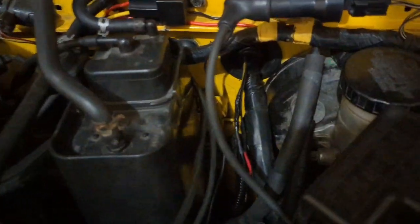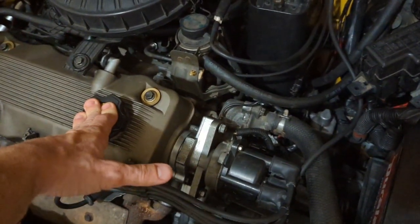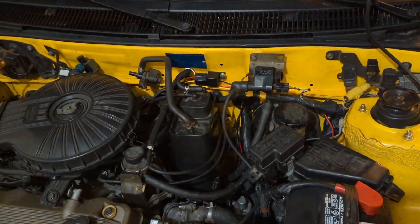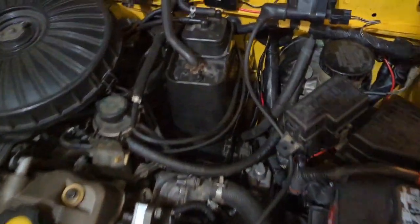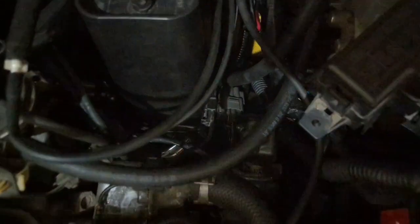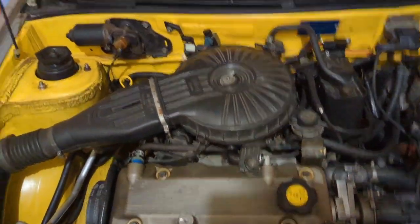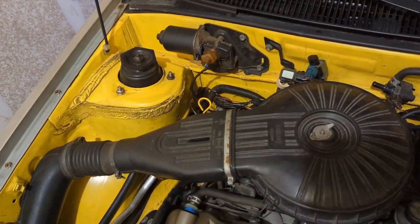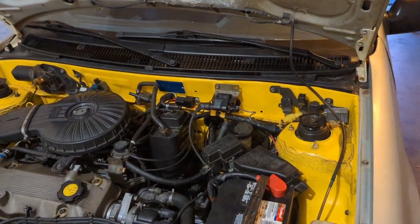I put a penetration through for the clutch start switch wiring. This is actually an automatic wiring harness — the engine came out of an automatic car — and I used its wiring harness and spliced in the needed connections for manual transmission components. The speed sensor for the manual transmission is actually on the cluster, and I wired that straight over to the ECU, which is underneath the climate control box in the cabin. The clutch start switch routes to the old automatic wiring harness. I also had to splice in the windshield wiper connector, since the connectors changed between 92 and 95/96.